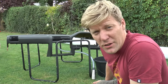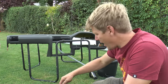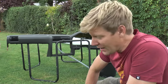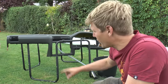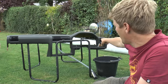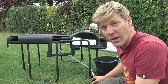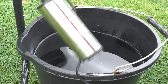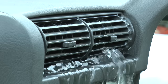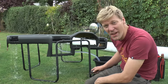One thing you didn't see in any of the construction videos is how we got the water to come out of the vents. Basically a little 12-volt submersible pump that dips in the water in the car, and then we ran an extra live up to a switch somewhere in the dashboard. There's some little plumbing in the back - a bit of hose pipe going up to that one, some little T pieces and bits and bobs in this one. I haven't bothered with the one over here because I didn't want the pipe to get in the way of the dashboard. Let's give it a test - there we are, it'll all gush out that one. And that was the effect I was looking for - that'll go in the car.